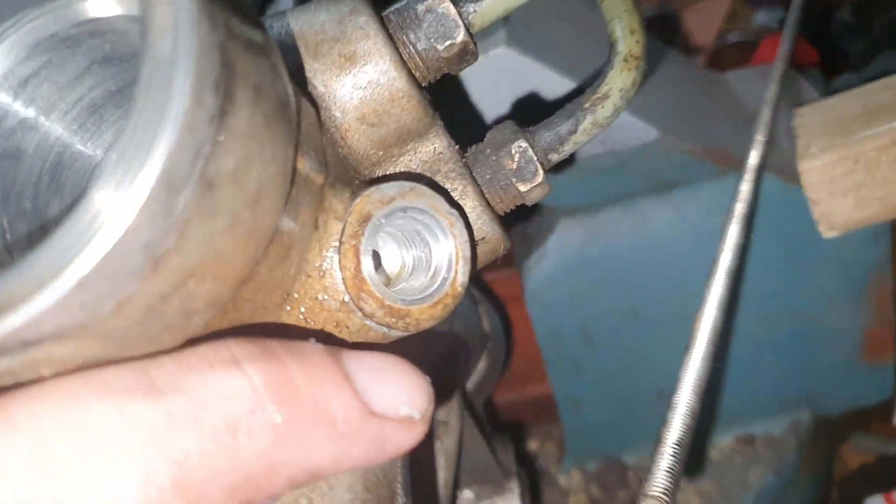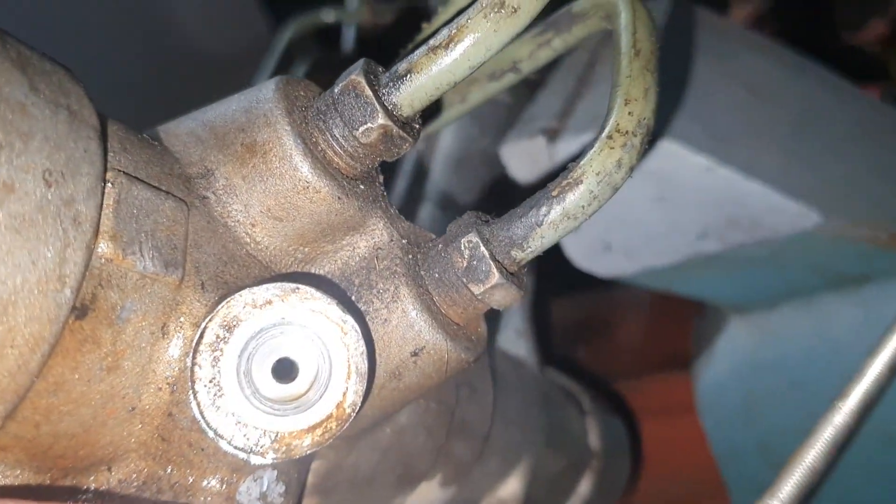So we do have a problem with the sensor — it actually stripped the thread in there. I have two solutions to fix it. The other one is to reroute the wiring to trick it so things are all good. It's just a sensor for power steering fluid, not really that important — it's not part of your engine. What we could also do is tap a different thread in it, put a bolt in it, then drill out the top of that bolt and tap the thread of the sensor into that, then drill the hole through it so the fluid can go through for pressure. Obviously we have to chamfer the edges for the O-ring and stuff, but that is the more desirable method because then we still use the sensor.